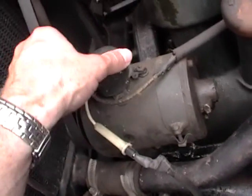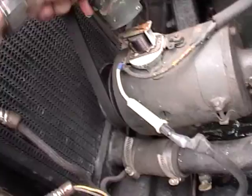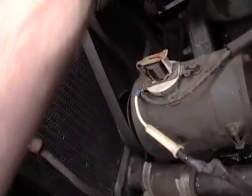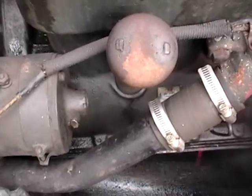The way to fix that is you come right here and pull the top off of the relay. And there's the relay. I'm leaking a little bit right there on that bolt too. So yeah, we need to rebuild. Might be part of why it's not running so well.